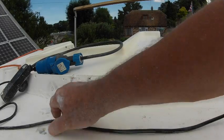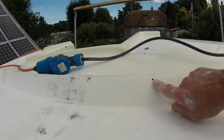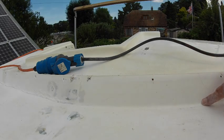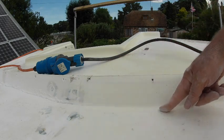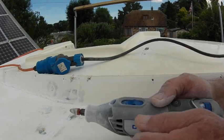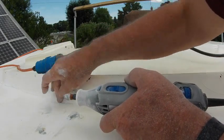I'm up on the roof now in the front part of the helm. This along here is where the screen goes - you can see where these holes are cracked. All these are going to be filled, but on the bottom part right there, all the way along, is a crack. That's caused, like I said in one of the other videos, where people are jumping down off locks onto roofs - it's not what they're built for. That stress can cause cracks, and this has got one all the way along. So what I'm going to have to do is dremel that out. Don't be worried about it - just get a dremel with a tip like this and trace it all the way through where the crack goes, and that will easily fill with an epoxy mixture.